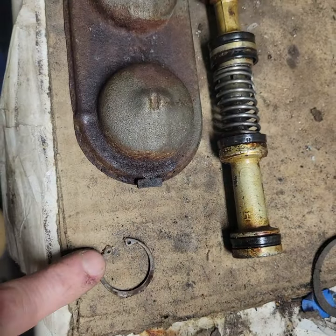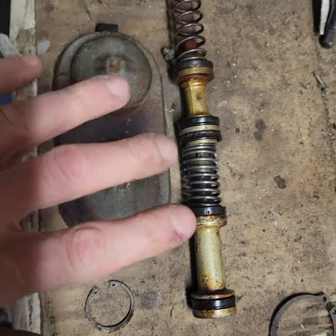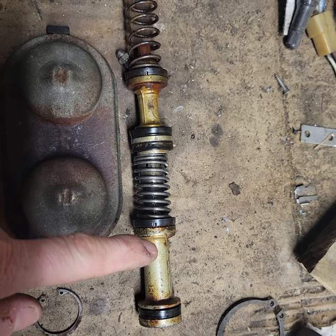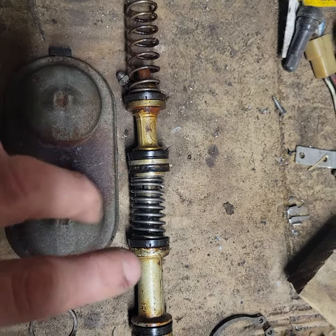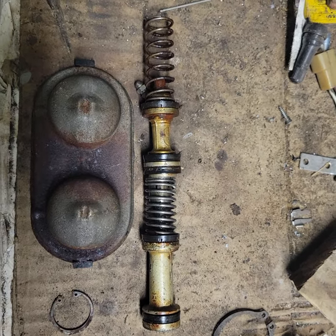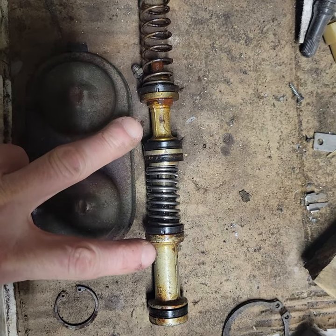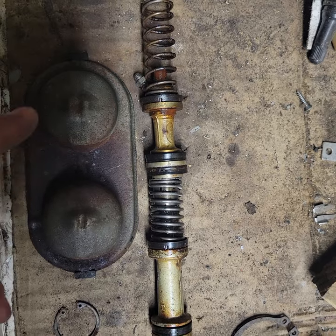This piece is the cover. When the spring comes out with the snap ring, we see the guts — basically a series of two pistons: the rear one for the rear reservoir and a front one for the front reservoir. Both pistons push the fluid from the reservoir into the two lines that go to the front and rear brakes. Both have springs on either side to push them back, and the fluid enters the chamber through the chamfer in the piston as the plunging cups push it through.